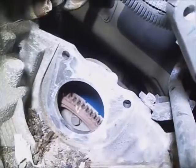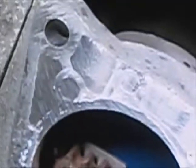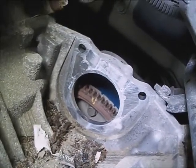Check the engine block for it not being shiny if it's all gristled up. Hit it with some real fine sandpaper to clean off any white oxidation so the starter will ground properly.